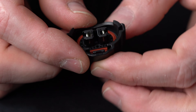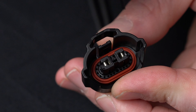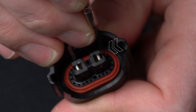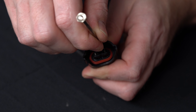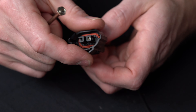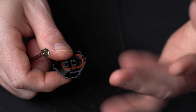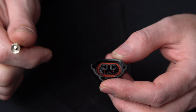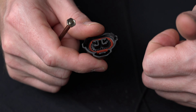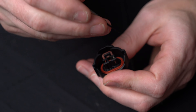I get a good pry right here at the back and lift right up on that front lock. On the Y210B3 the catches are on the top, whereas on this one the catches are on the side. Slide down the side, find that catch, lift up — technically lifting out to the side — and it comes right out. What I'm doing is making sure the wires are pushed forward and keeping them there as I'm releasing, then pulling back. Screwdriver in my right hand, left hand keeps the wire forward to get the tension off the terminal, then release and pull out.